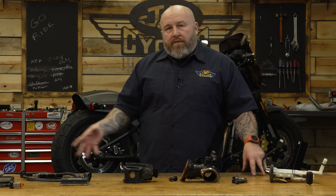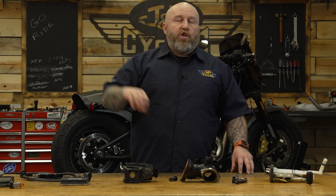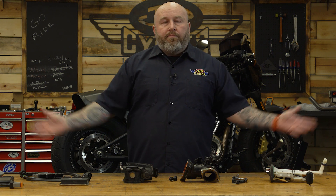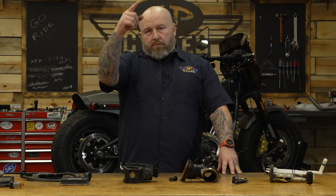You can add some fuel in there and cool the engine down. A lot of Harleys typically run lean and hot — that's why you get the heat on the inside of your legs. And if you do anything to change the airflow through the engine, whether that's an intake, an exhaust, or anything beyond that, you need to have the ability to match that change in your fuel system. As always, if you have any questions feel free to drop us a comment. Go work on those motorcycles!